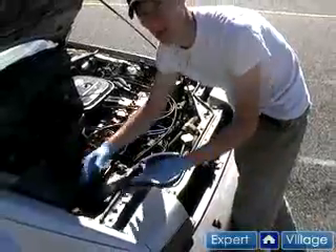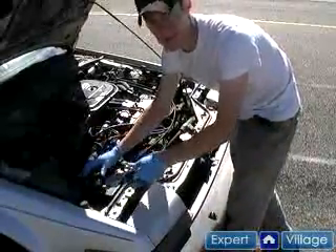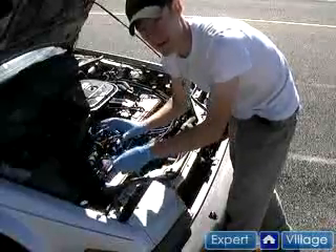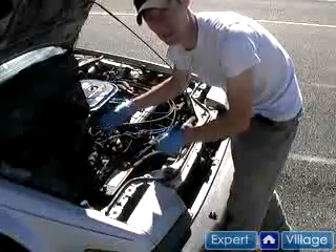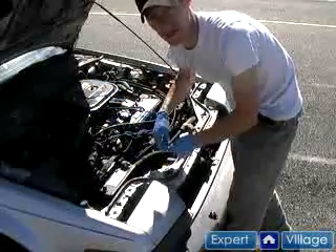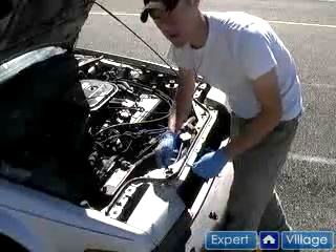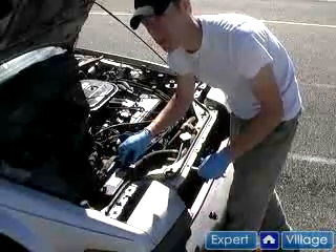But make sure you don't pour it into the fuse box. So first, let's clean these terminals and reconnect the battery nice and tight, and then see if we get any power out of the car — see if the headlights come on, see if the starter will turn the engine. I'm going to get a wire brush and clean these terminals.